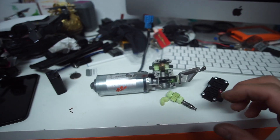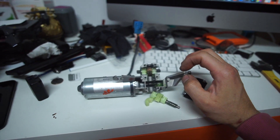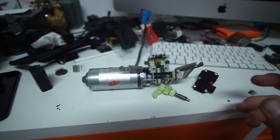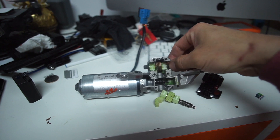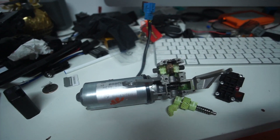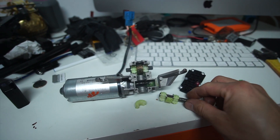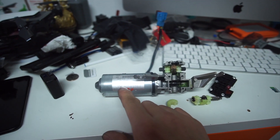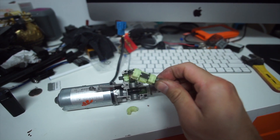Long story short, I installed the motor into the car - the new part I purchased on eBay. The motor works perfectly, it spins when you click the switch, but it wasn't engaging with the latch. So I took it out and here in my office I'm dissecting it to see what's going on. Ended up that the gearbox gear inside the motor - this is the gearbox - it was cracked and broken.